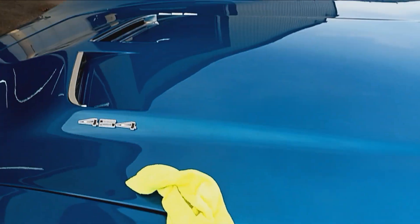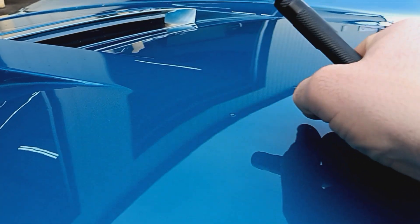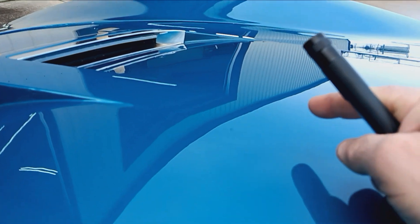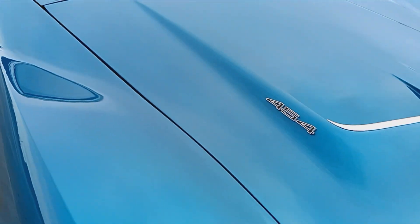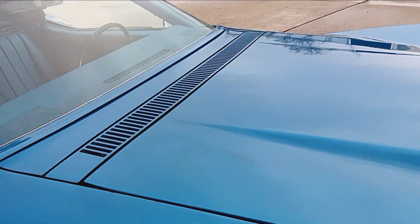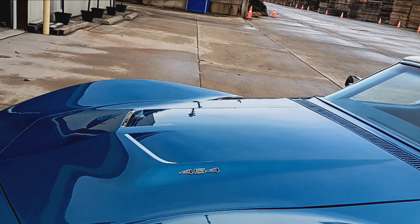I'm standing up, touching the car right now. If we get right here, I got a little fisheye here. I've not yet tried to wet sand that out or anything yet, but just a little bitty one. Two more next to it — one and two. So quite discreet, really. I think you probably have to be a professional to notice these things. Otherwise, no big shrinks or anything like that anywhere. This car is base coat clear coat, so we might just try and wet sand that a little bit and see what happens.